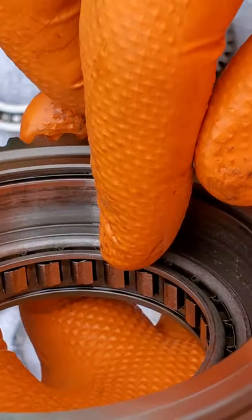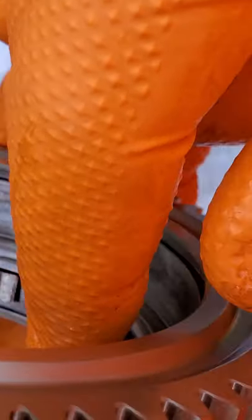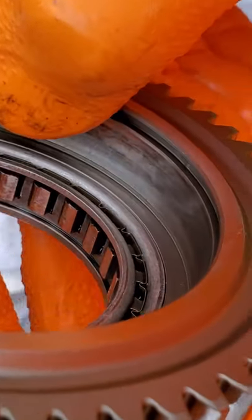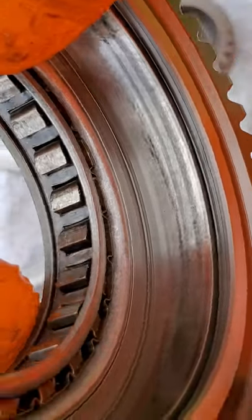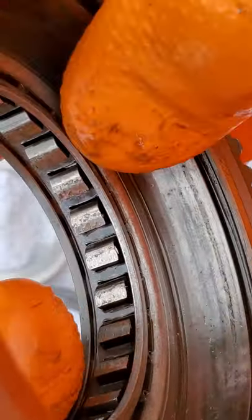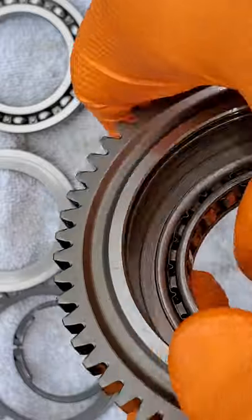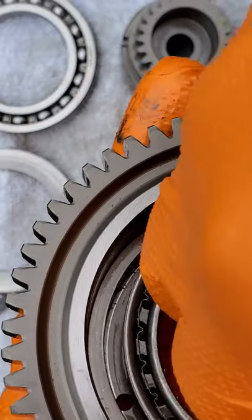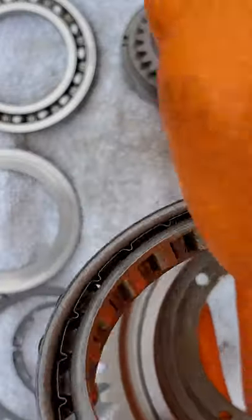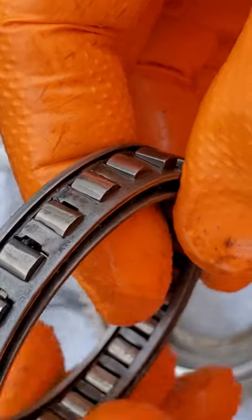The edges of these sprags are totally blown off. They should come out to a nice, round, even plane — they don't. All the way around, totally destroyed. You have hardened steel pressing against hardened steel, and still everything wears: the sprag wears, the inner wears, the outer wears. These guys are just gone — toast. No signs of overheating in here, which is a good sign of good oil in the system.